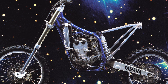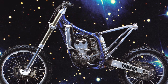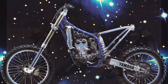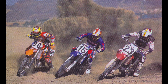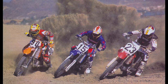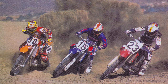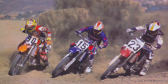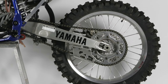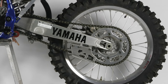While not as trick looking as the Honda's aluminum frame, the Yamaha steel frame construction did have its advantages. Without the Honda's massive frame spars, access to the motor and carburetor was much improved, and the bike was also slightly thinner through the middle. Cosmetically, all three 450s were handsome when new, but the painted frame, dark blue plastic, and flimsy graphics of the Yamaha tended to show their age far quicker than the competition. The powder-coated frame of the KTM and the bare aluminum chassis of the CRF looked new longer, and both offered graphics that proved more robust under hard use. The butter-soft steel bars, flimsy stock sprocket, and stretch-prone chain were par for the course of the Japanese bikes of the time, and all three paled in comparison to the higher quality components found on the KTM.